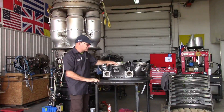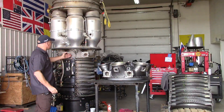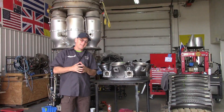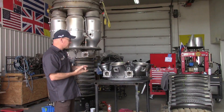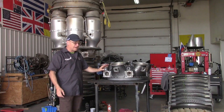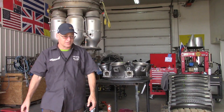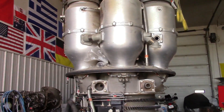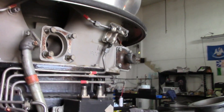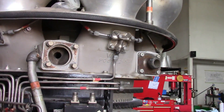Now, in order to paint the mid frame — mainly for corrosion protection — I asked the owner at Oshkosh what color he wanted. He said 'what do you mean?' I said, the stock color is like beige or gray or brownish — it's like if you drank a vanilla milkshake and threw up. Not very attractive. So I thought, how about something like titanium silver? This is called platinum metallic charcoal and it's awesome — super heavy-duty paint, actually automotive paint but rated good for 550 degrees Fahrenheit, which we checked with a heat gun and propane torch.